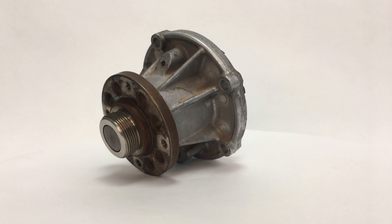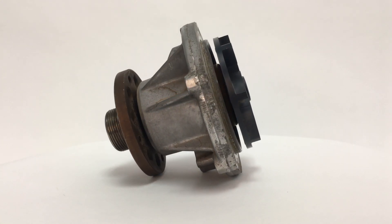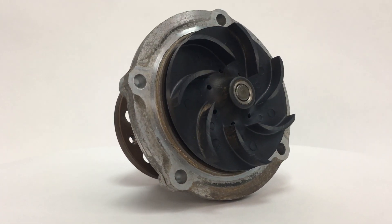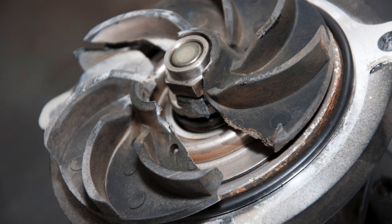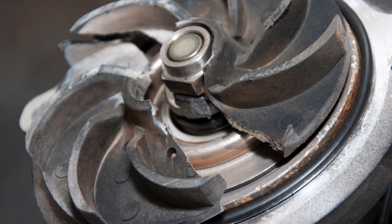Shown here is the stocked 6-liter water pump. It's tasked with pumping coolant throughout the engine, keeping temperatures within operating range. However, it has a plastic impeller, and over time it can get brittle and crack. When this happens, coolant isn't effectively being delivered throughout the engine, and an overheat situation could occur.